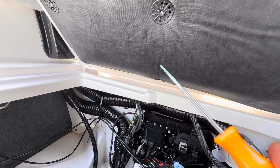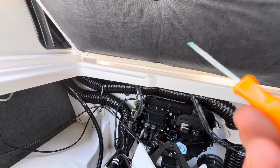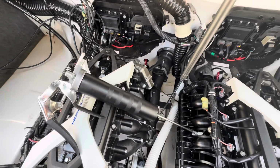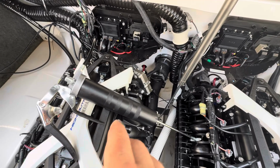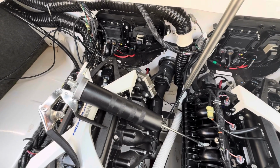All right, so I'm probably gonna follow the directions and do 6 to 11 cc's of grease into the intermediate shaft bearing. All right, so my other grease gun that I knew did 0.5 cc's decided to shit the bed, and it doesn't want to pump anymore.